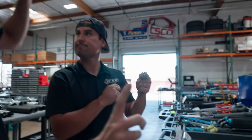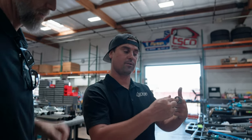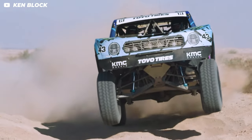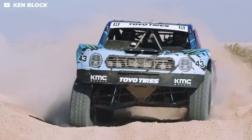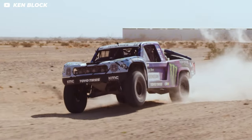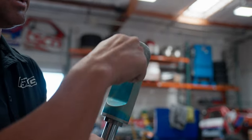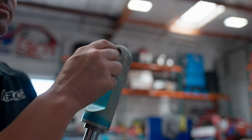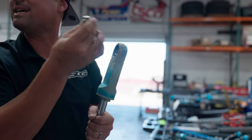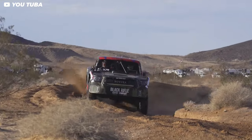The sphericals live on each end of the shock, connecting the suspension and the chassis — that's what the bolt threads through. When these wear out, it turns into like a slide hammer, beating the steel and opening up the eyelet. The bushing is pressed into the aluminum eyelet, and when it slops out it opens the aluminum so the bushing won't stay tight. If you wait too long, you have to replace the whole eyelet, which is much more expensive than just replacing the spherical.